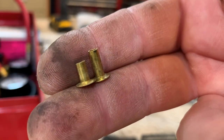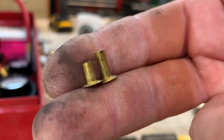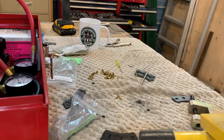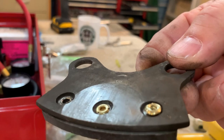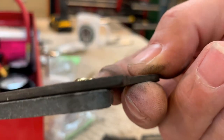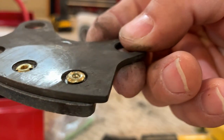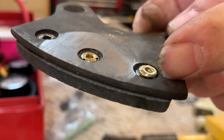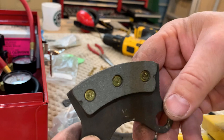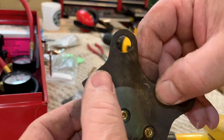You can see that the kit comes with two different sizes — one is narrow or shallow, and one is long. Here I've accidentally installed the wrong one. See that one on the end? This has to be flush like the middle one, so I have to drill this one out and start again. I've drilled that out and have installed it correctly now.